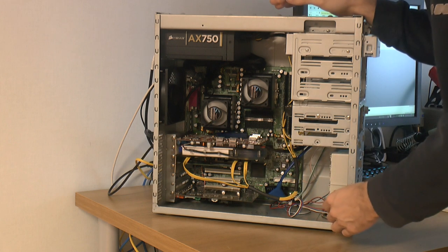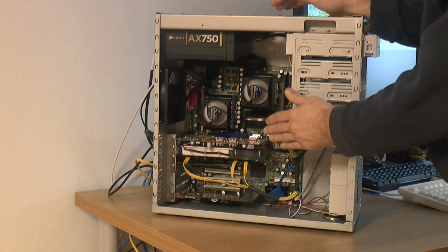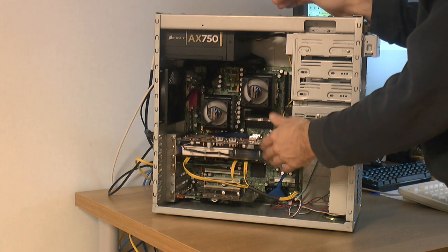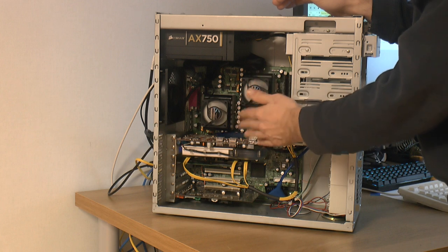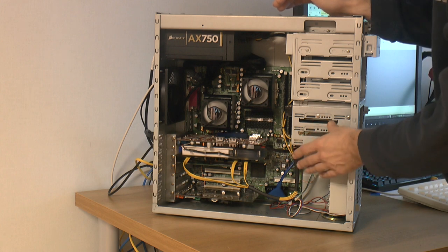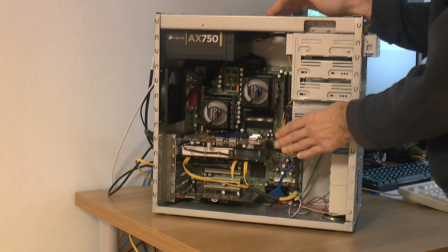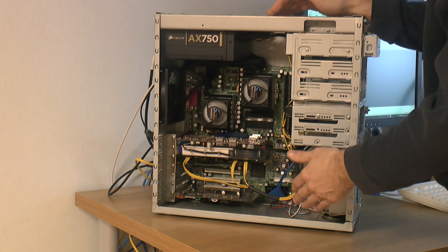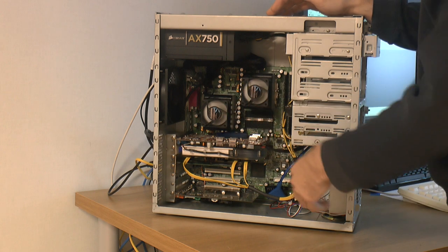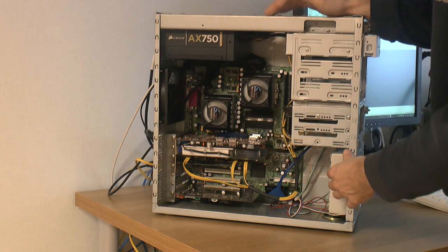Would I recommend building a system like this? Yeah, despite what I read — I'm really surprised by how stable this platform is and how well it scales with two CPUs. It's not 100 percent scaling, and you're not going to get that, both due to sharing the bus and memory and because most software doesn't scale linearly with CPUs. I would actually highly recommend building something like this, but not if your target is only games — more if you want some 3D rendering, running a server or two at a LAN, or just for fun, because it's fun to build dual processor systems.